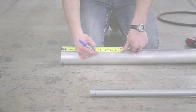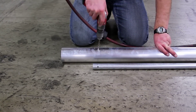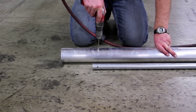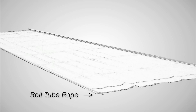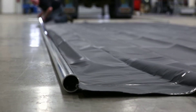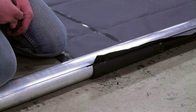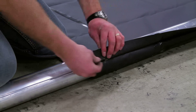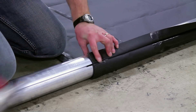Step 8. Refer to the instructional manual to determine hole placement. Use a 7/32-inch bit and drill a hole in the marked locations on the roll tube. Step 9. On a clean floor, lay the tarp out flat with the rope and exterior side to the top, hem edge and pocket down. Align the channel on the roll tube with the rope and slide the roll tube onto the tarp rope. Make certain the rope is fully engaged in the channel all along the tube. Align the rivet hole at the front of the roll tube with the rivet hole in the tarp. Insert a black finish drive rivet into the hole, making sure it is fully seated and set the pin with a hammer.